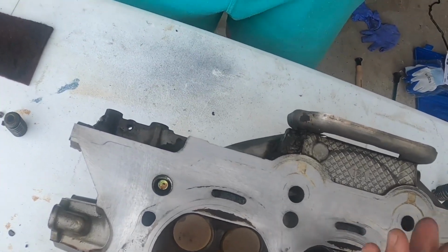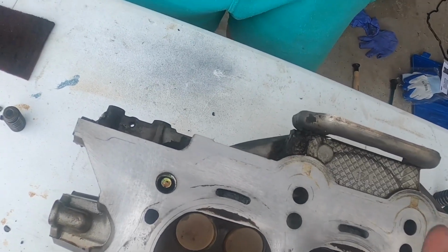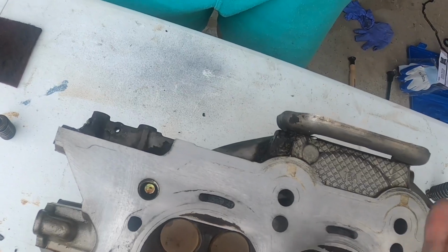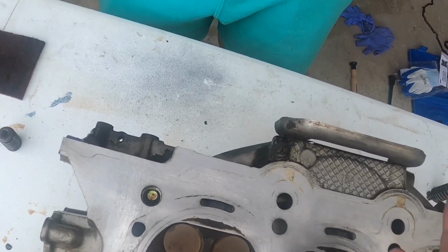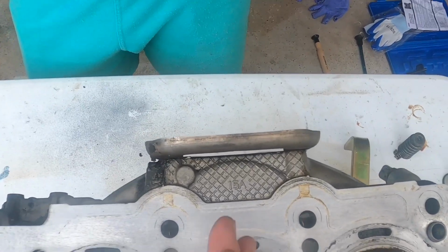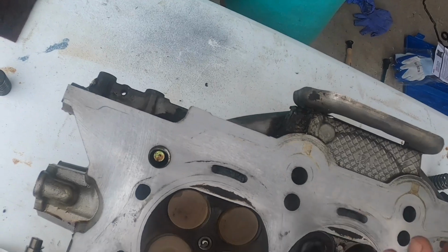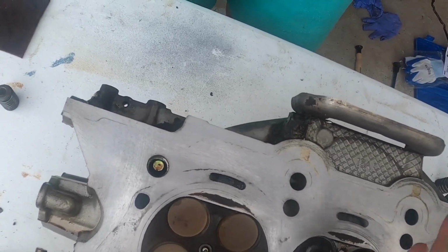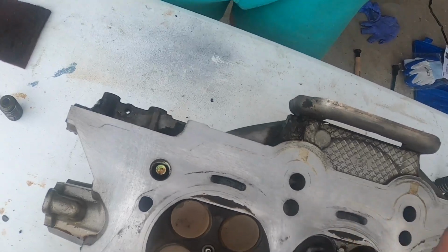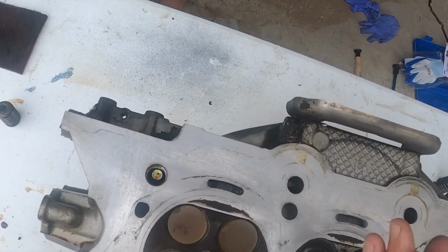Tiny little cracks. And you'd think because it was cold, it wouldn't be able to push that through there, but somehow it was. Just enough. 80% leakage, though. You'd think there'd be a big hole in the damn cylinder, you know? But when you got one, two, three, almost four cracks that run the whole length of it, it's leaking all that pressure through there. It's enough. Yep, sure is.